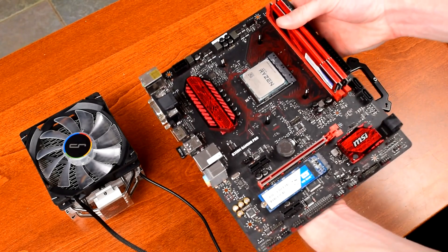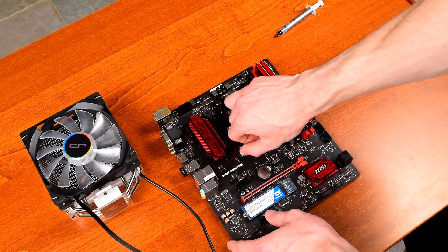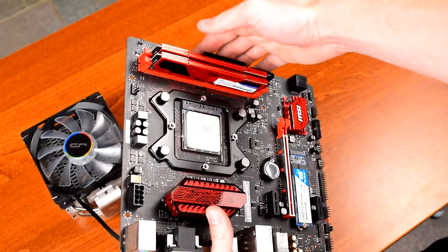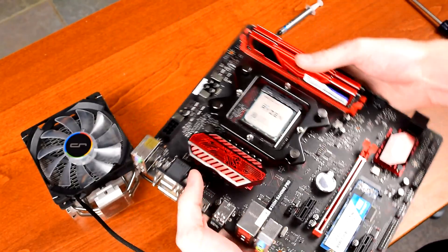Next, line up the top plate with the mounting screws, make sure it's all aligned, then simply screw down the mounting nuts. One thing that threw me off was that the backplate isn't completely fixed before you install the cooler — it won't fall off, but it doesn't sit still either. I would have preferred a rigid mount right from the start, but it's not too big a deal.